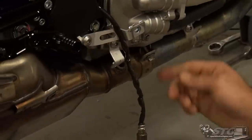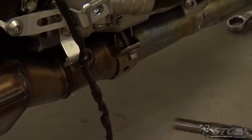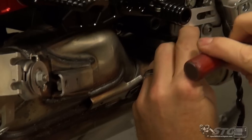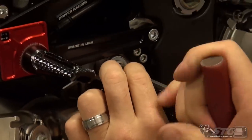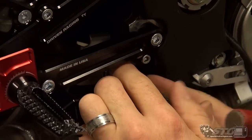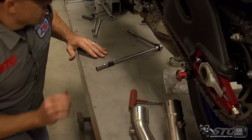I've got this O2 out — we have one on the other side as well. Here is our clamp on the stock muffler box — a 10-millimeter socket and ratchet, or a wrench if that's what you have. Staying on this side of the motorcycle, we have our stock mounting hardware for the muffler box. Go ahead and loosen that up — there are three stock mounts. Keep all the hardware to the side; never throw any bolts away, always put them in your spares. Note: when you install this Cat Eliminator, you are circumventing the emission system on the motorcycle, which could be in violation of EPA regulations depending on your area. This is technically a closed-course-only modification.